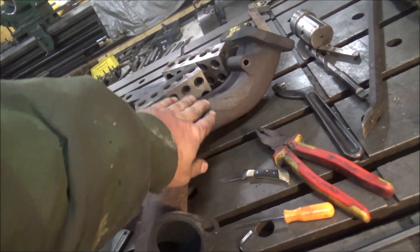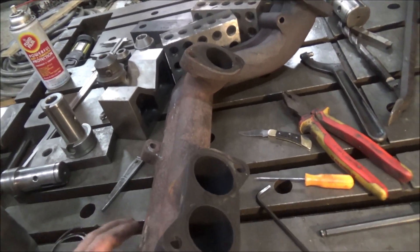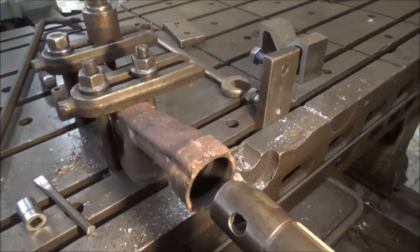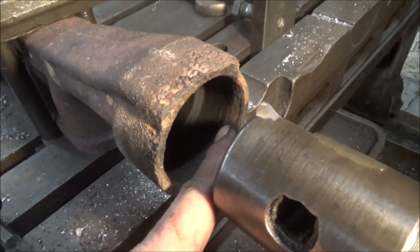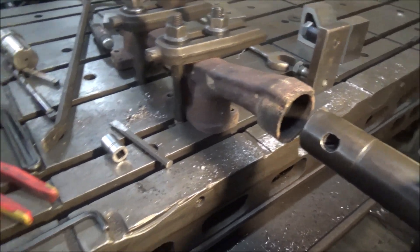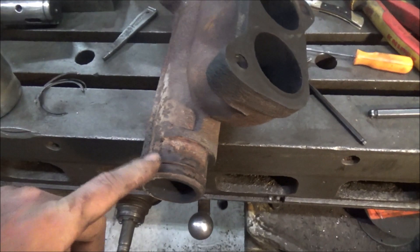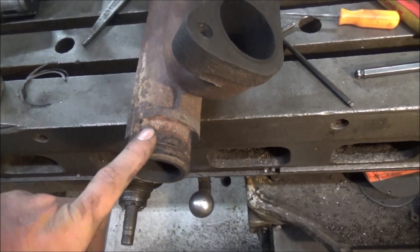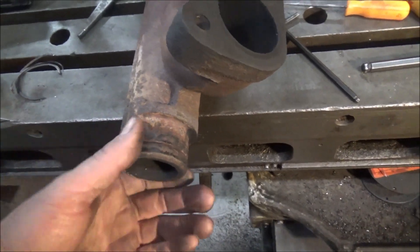This one here you might do on a belt sander, but they're just going to mill it anyway. The pocket up in here is shot. See the groove there — there's a seal ring in here that has worn that out and it won't seal up anymore. So you've got to bore this out and put a sleeve in it to get it back to fit nice so it'll seal up and quit blowing exhaust gas and turbocharger boost drive pressure out.